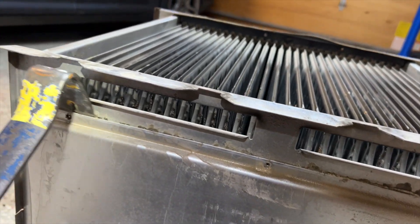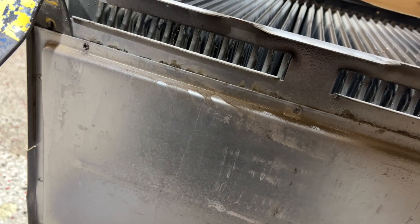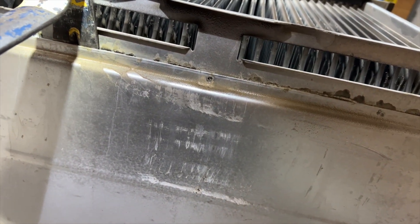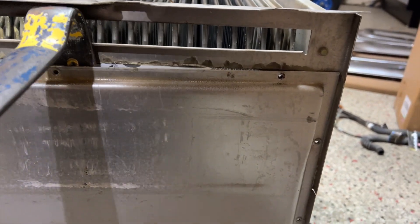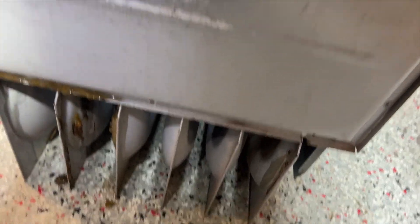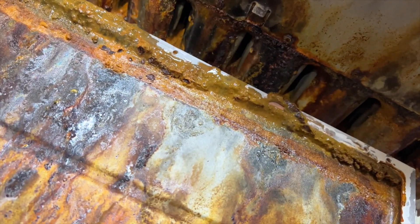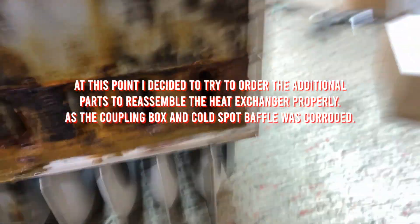I got all the screws off this back plate. Now we've got to kind of pry it because there is a sealant on here — just carefully pry it up. There is a sealant adhesive on here, which is another reason I don't like reusing these parts. You have to be very careful not to damage it, just take your time. Now when we pull this off we're going to see how nasty this heat exchanger is — you can already see nasty goop coming out. That's really bad. I have to reuse this plate.